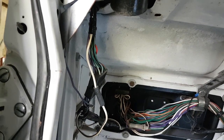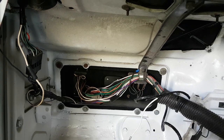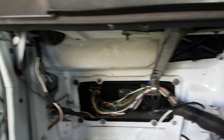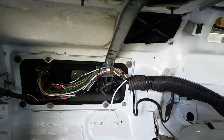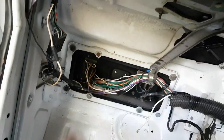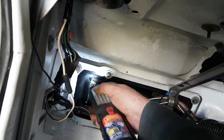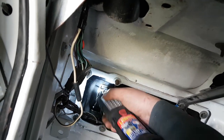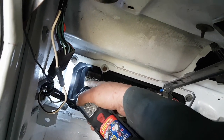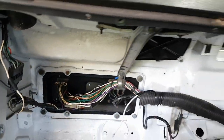So I cut that, put a bullet on each of those, put a double on it, put a loop around to go between the two. And that will then give me a positive feed to both of the white circuits unfused. Good grief. I must admit, when I took this loom home with me, I did strip the whole damn thing down and rebuild it. So it's possible that the wire had been cut up here. I can't see too much evidence that it ever existed up there. It could have just been pulled out. You see there, there's two wires going in there and a bridge between them. And I think it would have been exactly the same there. Okay, I know what I'm doing now.